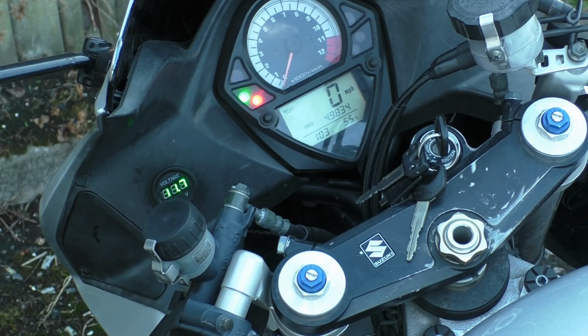Maybe I've got a cell going out on the battery, maybe it's just had enough. But it'll hold a charge of 14 volts, and we'll actually see what the leak down voltage of the battery is. There's loads of things to go through here. It looks like we do have a leak. Someone brought up a very good point about setting the milliamps for doing the ground leakage, and like a knobhead it was set to AC, which is wrong.